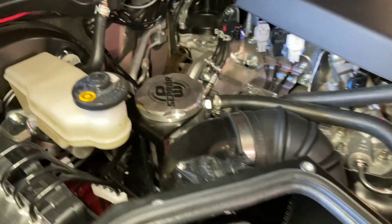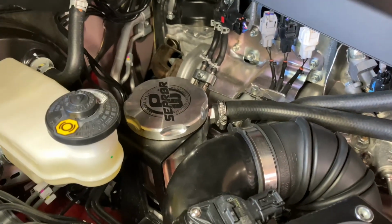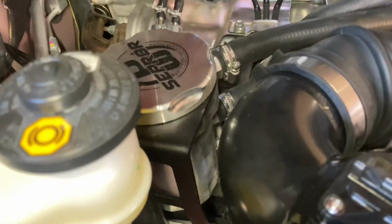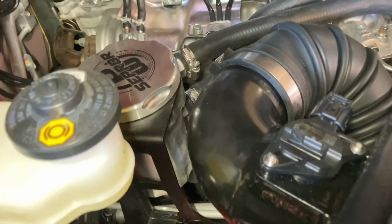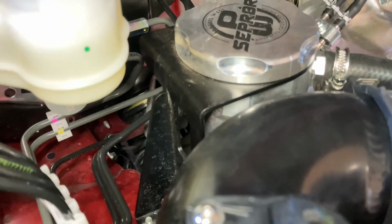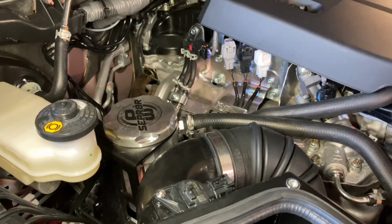What I mean by mucking around is I actually had to move the oil catch can. So the oil catch can was about 50 mil further forward of what it is now. And it was interfering with the intake pipe that leads into the new airbox. So yeah, I just had to shuffle it back. Just trim a little bit off the side of the bracket there to clear those brake lines. But yeah, that's all in with 3 mounts as it was when we first fitted it.